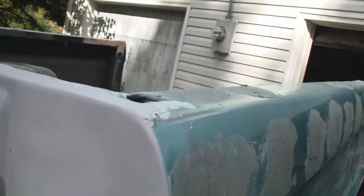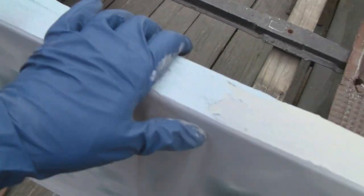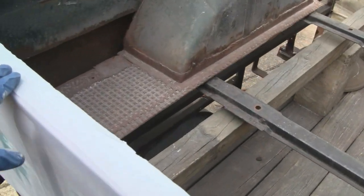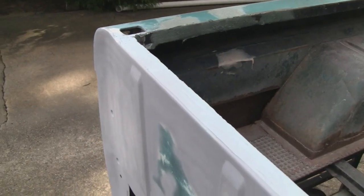What we're going to do now is I slapped some putty up here before I did all this priming. That way all this putty would get on fresh steel. So this top rail is ready to sand. I think maybe I'll try and sand that since we got a little time, right? Alright, slow down, slow down.